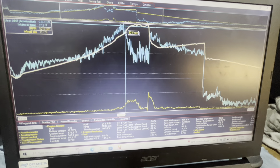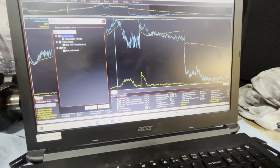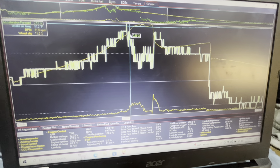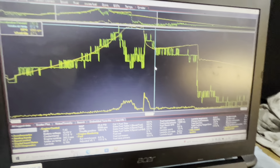I can actually throw on the acceleration channel and it will come over — it looks a little different than the raw solid data. I'm more into the raw data. So guys, that's going to do it. I hope you guys learned a little bit about G meters today and how to wire them up — they're real simple: 5 volt source, ground source, and then just an input that goes right to your ECU, and your ECU designates what voltage is what G. Really cool little tool.